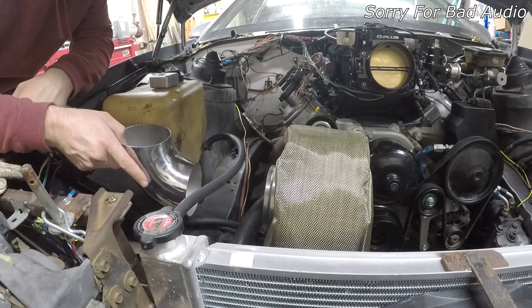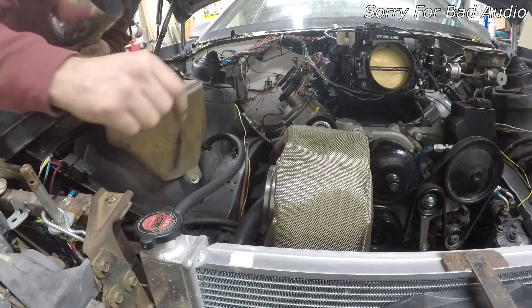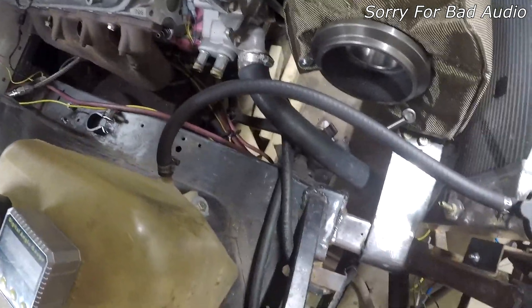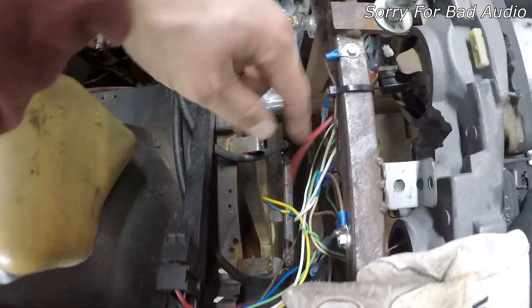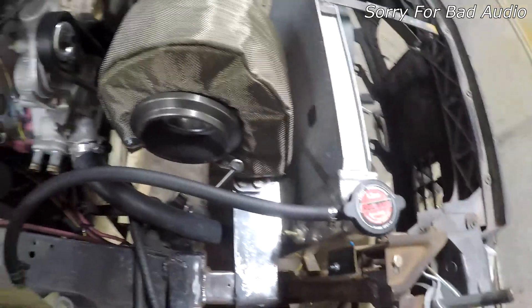We've also got dual wastegates. If I move that radiator hose and snake it around over here and go down, I might be able to get the wastegates connected right to that 5-inch — which was the plan. I think that's going to work. Then I'll move this hose, snake it around here and come up through here — I don't think that will matter that much. So the plan is: I'll break those welds, re-tack it, hopefully finish weld it, and then I can keep the turbo flange on there and start building the hot side up to it.